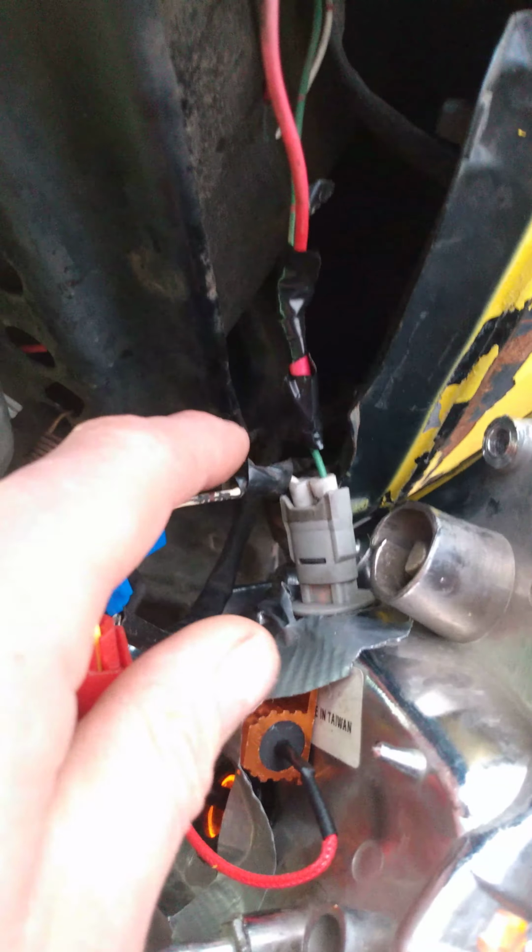You clip the marker light wiring. Clip the ground wire from your marker lights. You run that ground wire into the positive wire of your blinker circuit. On this truck, it's a green and black wire. That'll cause it to blink with your blinkers. And if you turn the blinkers off, you got just a solid marker light.